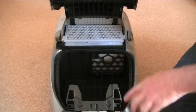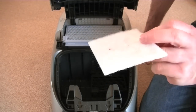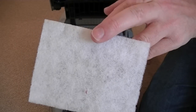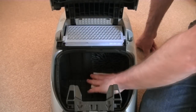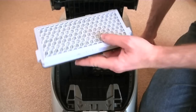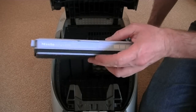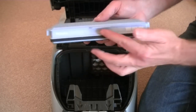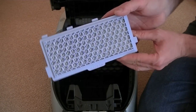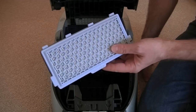You also have extra protection with a motor protection filter — apart from some very fine hair, it's pretty clean, and I've never had to change it because the bags are so efficient. We have the final HEPA filter here — Miele recommends about once a year or approximately 50 hours, and the machine will tell you when replacement is recommended. The newer versions actually have a timeline strip that tells you when it needs replacing. These can be quite expensive — about £20-something in the UK. There are cheaper filter variants available that you can replace after about four bags, but if you really want clean air, the HEPA is the way to go, especially if anyone in your family has allergies, asthma, or any dust-related condition.